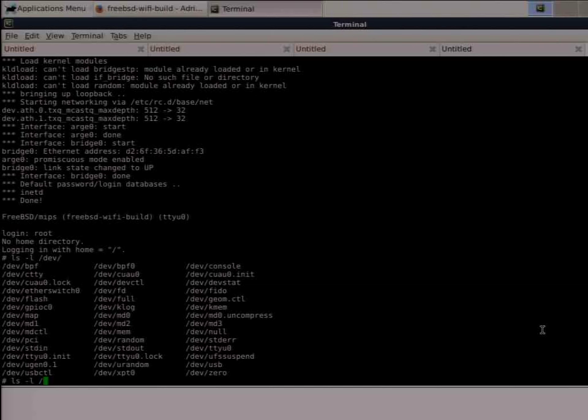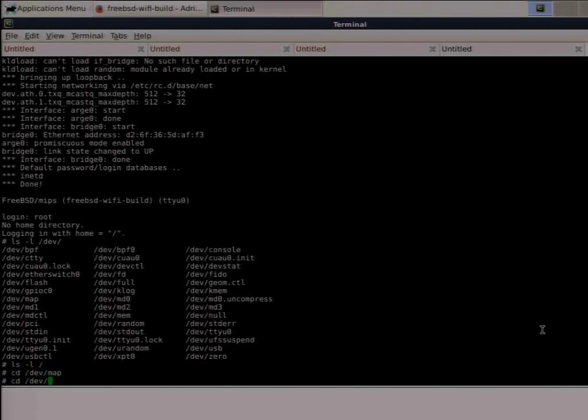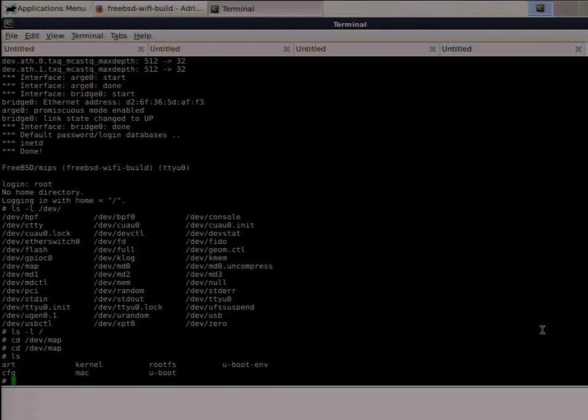All the Atheros drivers assume that there is going to be a flash configuration partition, and they're going to be able to go into that flash configuration partition and find out all the magic signaling bits that are inside of it. Hold on. I have to remember where it is. So does that actually work when you bring up the wireless, because it will go and grab configuration data and everything? Right now? Yeah, I could. All right, so...